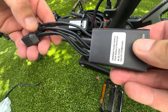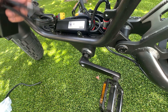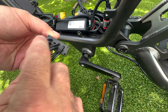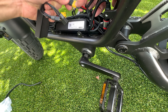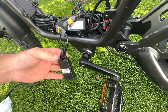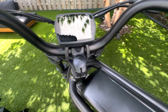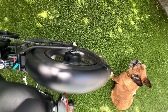I'm going to take my 40-amp balancer, place it in my hands, come up here to the power connections, and pull up from there. The balancer has two inputs and one output — the output goes to the controller. I'm going to plug it right into the one that leads to the controller. This line is for the factory battery, so I'm going to plug that in. We have power on the bike — that is good.